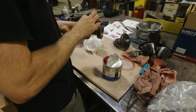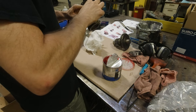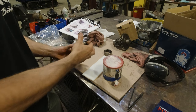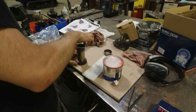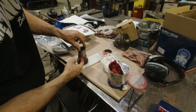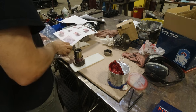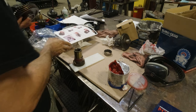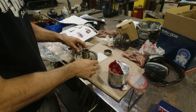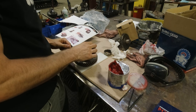It is finally time to start putting this crawl box together. The first step is to slather the provided coupler with some grease near the base and then install the cage bearing from the old transfer case over top — it should slip right on with the grease. Put more grease on that cage bearing so the low speed gear installs smoothly over it. Here is the 4.7 low speed gear — pay attention to orientation when you put it on. It should slip right over the cage bearing and spin nicely. Then install the provided spacer on top of the 4.7 low speed gear.